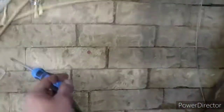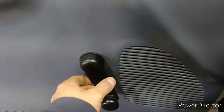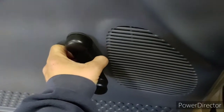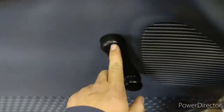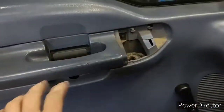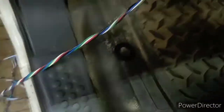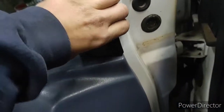Don't put a whole lot of pressure or you'll break it — just like that, very easy to do. Toss it to the side and you'll have a seven millimeter in there too. If you're doing a manual, there's a little cover on here that pops off. There's gonna be a T20 torx behind that. Get that little screw and then it just comes off. Take two seven millimeters off and then this whole door kind of slides up and off — pretty simple. One thing I forgot to mention: the window crank — there's a little cover that pops off and there's a T20 torx; a little washer kind of sits between that and the door panel. Pop this off — I've learned, don't try to pry it this way, pry it this way and they come really easy.